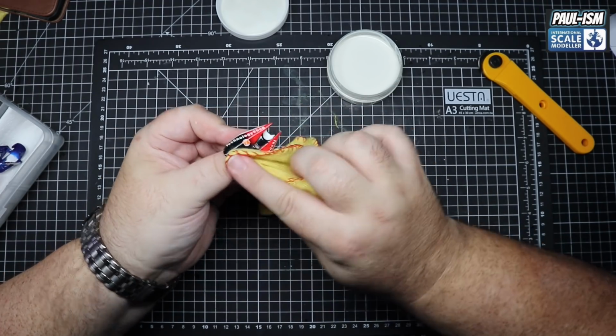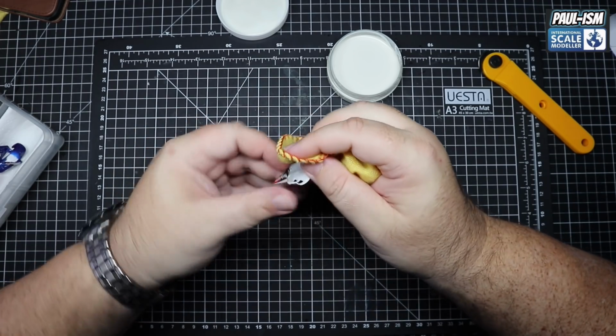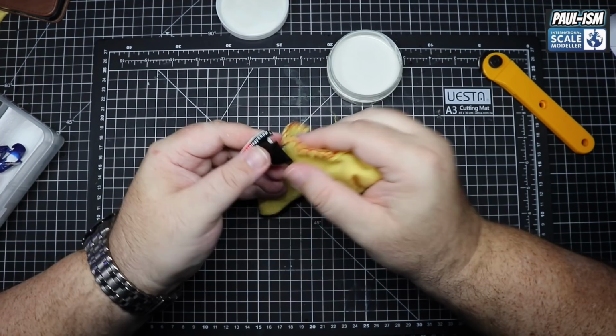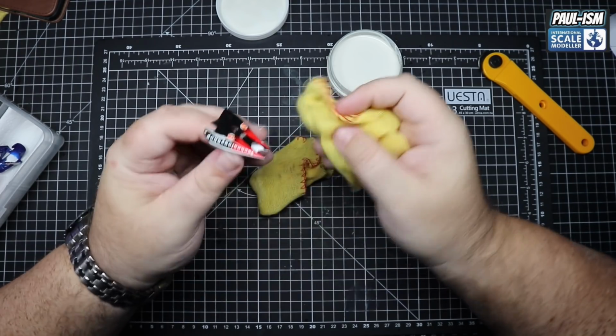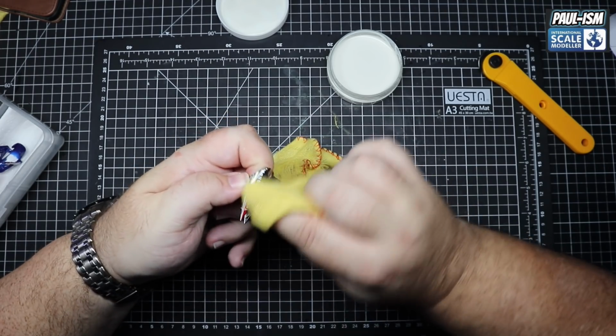We're lucky to get a very nice 2K job out of the gun. We probably could have even got away without polishing, but it's a good final step to do. Make sure you get the best out of the finish that you can. And then at the end, we can give it a wax as well and give it a real nice shine up.